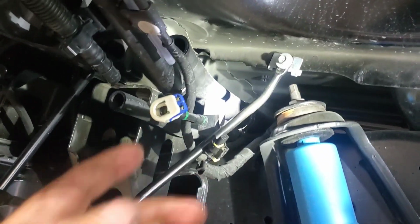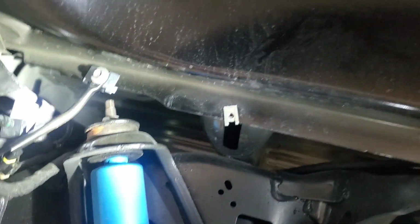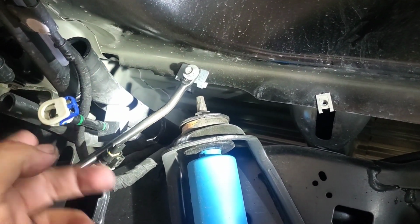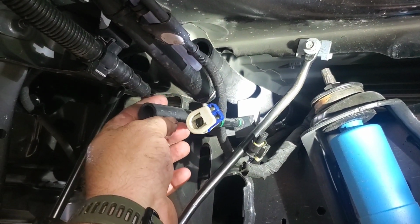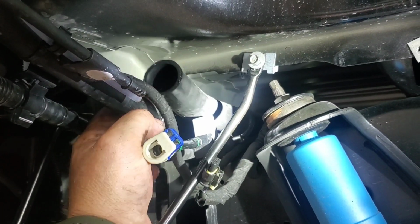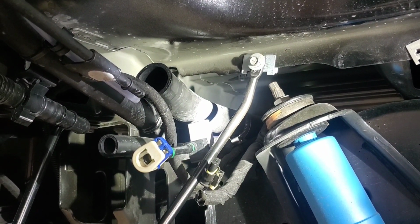Okay, so I got the hoses off. They're a little tight, but it's not that bad. But so I took all this fender well stuff out, undid this. You lift the blue. Underneath there's a button to press. I figured it would be easier to pull the tank out with this attached to the top, and I can take it off afterwards. And then this goes to that big canister, and this is the fuel fill. So I'm just going to take it down with the tank, switch it over, and then put it up on the new one.